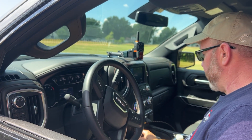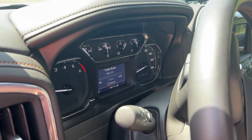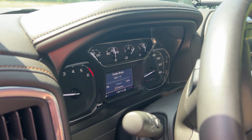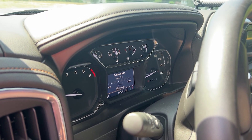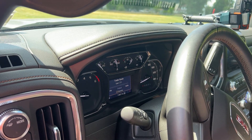When you're towing big trailers, it's super helpful. The plus or minus is here when you can set it for what you want it to be. You can see the gain is set at 0.5. You can set it all the way up to 10 if you hit the plus — see, it's starting to go up. It's somewhere between 8 and 10 normally. Once your brakes become more worn, your gain will typically go up, which usually means you need to adjust your brakes.